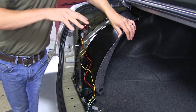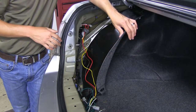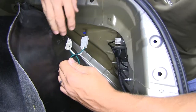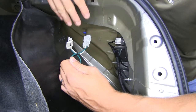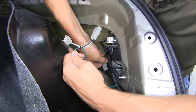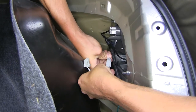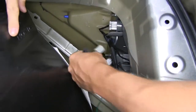With the driver's side done, let's go ahead and repeat the same process — removing the pushpins and carpet on the passenger side — and then plug in our green wire. Since we already tapped into our running light circuit on the driver's side, here on the passenger side all we have left is to plug in our turn signal, which is the bottom connector. We'll simply unplug it, plug it in here, and then re-plug it in here.